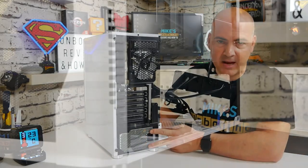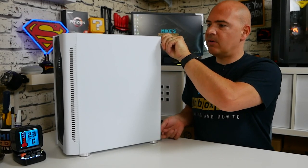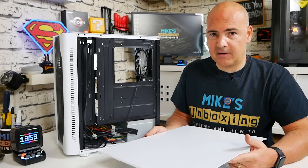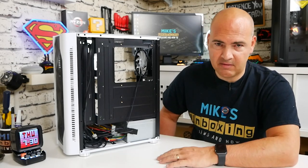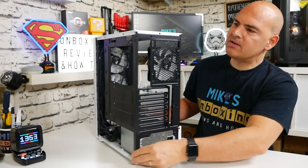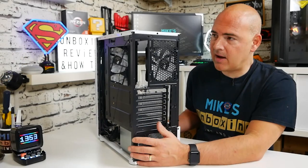At the bottom is your standard ATX power supply mounting area with no extra bits of metal to bend out of the way. Moving to the back panel, we have thumb screws rather than captive ones, and it's finished in a nice white gloss. The panel has quite a lot of flex to it but is sturdy once in place. There is a useful little cable mounting area at the back for the 120mm fan cable, so it stays out of the way when you're fitting the motherboard — a nice touch that more case manufacturers should integrate.